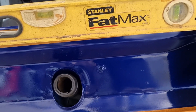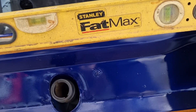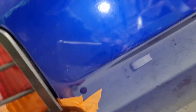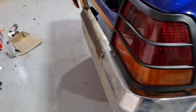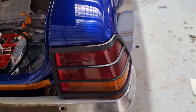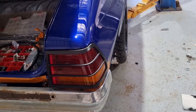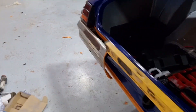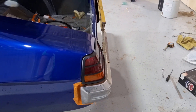So what we're going to do now is measure the distance between here and here — top and bottom — make sure it's square. Then I'll cut the middle section, bring it back over here and we'll piece it together and see what it looks like. To be honest with you, I'm not 100% happy with it. But it's the way the HZ series are — I wanted it right back in, tucked up high here, and it just won't. You pull the bumper in — you saw it in the other vid — the light sticks out and it just looks weird. So that's about the best I'm going to get it tucked. But it'll be right once we get it painted up — it's not bad, pretty square, a lot better than what it was.